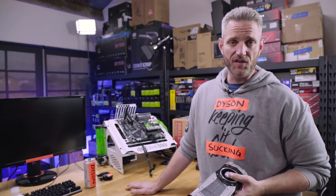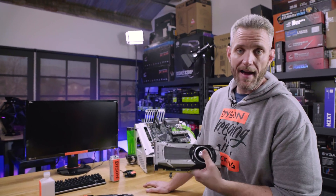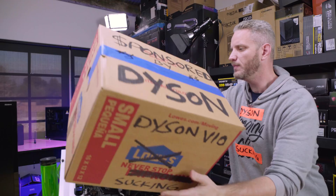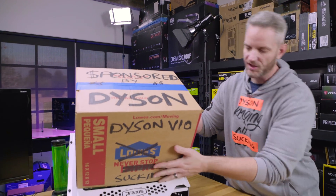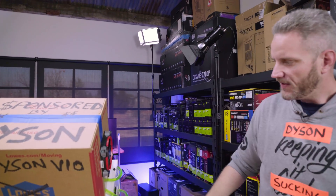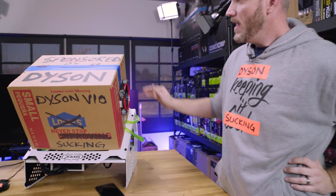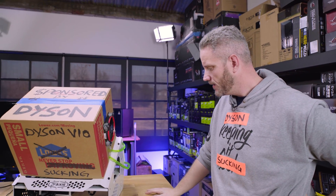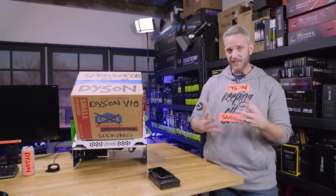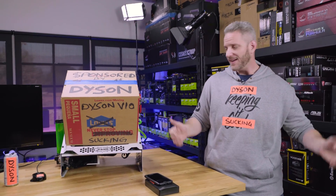My prediction: I don't think anything's changed. I really have no idea why this card started running hotter. A lot of people complain my test bench isn't realistic because it's open, so we've fixed that with help from one of our sponsors — it now has a fan on the side pulling in cool air, more reminiscent of a case. Settings: 55% fan speed, max power slider, max temp slider. Let's run it for about 20 minutes to equalize temperatures and see if it came down from 88C.